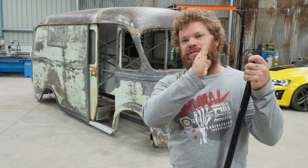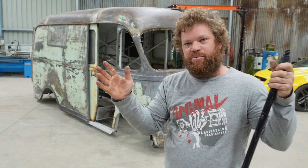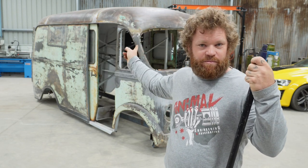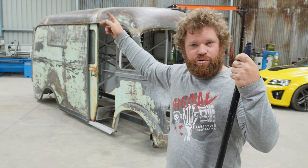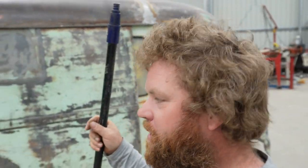Pull the internal panels out so you can access all those welds. Go through the inside and cut those welds around the top. Cut the welds joining the roof to the body on the four corners, and the roof should come off. I'm assuming this is a 1960 Metro and that the rest of them are basically the same — that old word, assumption.